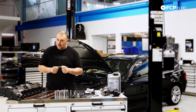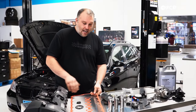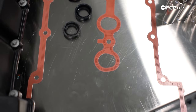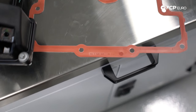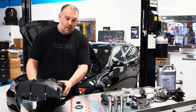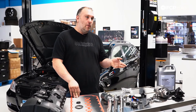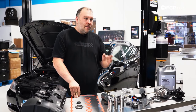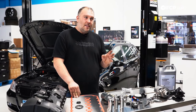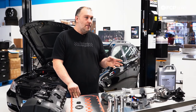This engine is no different. One of the most common oil leaks you're ever going to get is a valve cover gasket leak. This valve cover gasket is for the magnesium valve cover version of the N52, so it's basically the gen 1 version. The gasket on this valve cover is straight rubber, while the gen 2 is more of a composite. It's also worth noting that the magnesium valve cover version uses aluminum one-time-use torque-to-yield bolts. I'm not saying they're guaranteed to snap off, but some of them do upon removal — fortunately they're not torqued very tight, so if the head does snap off you can still easily get them out.